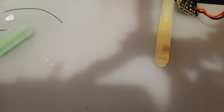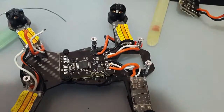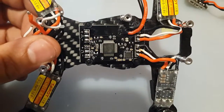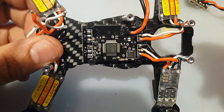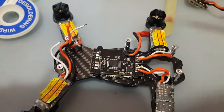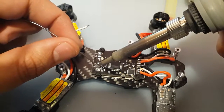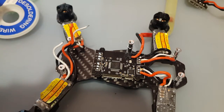I think we bridged many things. I had to fix that off camera — it's fixed. You really have to be careful with this. The solder jumped to the capacitor and jumped to this voltage regulator. Now we're going to do positive and negative on this pad. Be careful — it's a very tight spot. Don't put so much, and make sure you keep the solder tip clean. Don't do it on camera like I am.